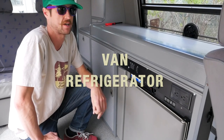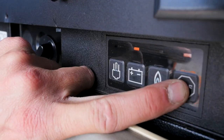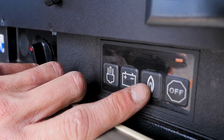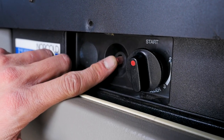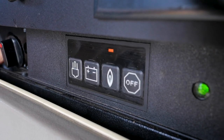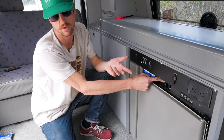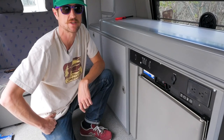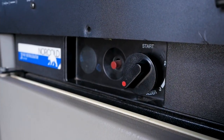The third propane appliance inside your van is your refrigerator. To light the fridge on propane, start in the off position and roll the thermostat back into the start position. From there, click on the flame icon. You'll hear the igniter ticking a bit. Then push and hold in the red valve right here until the green light on the fridge turns on. Once you've got a green light, keep this button held in for another 20 to 30 seconds until you can let off and the light stays green. From there, make sure you turn your thermostat over between 4 and 5 — you're going to have a nice cold fridge for your trip.